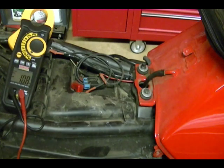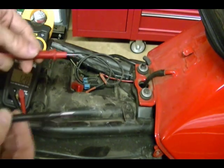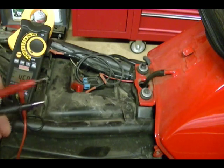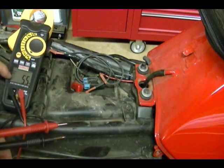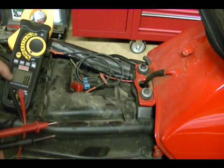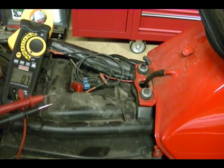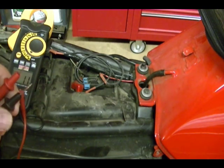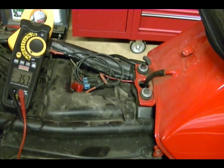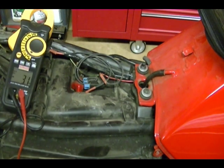When you use your meter, make sure your red lead is on the positive terminal and your black lead is on the negative terminal. If it's not, you'll get a negative number on your meter. It won't change the magnitude of the number, it'll just show a negative number instead of a positive number when the leads are reversed. Anyway, that's all there is to it to check your KLR and make sure it's putting out the correct regulated voltage. Hope you found this video helpful, and thank you for watching.